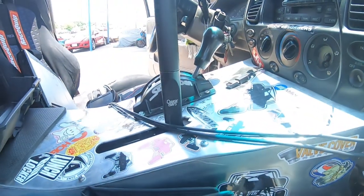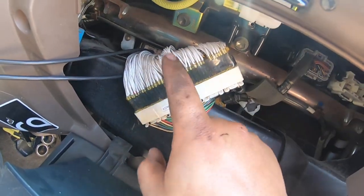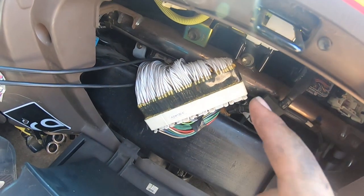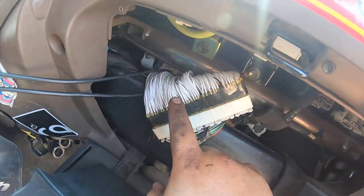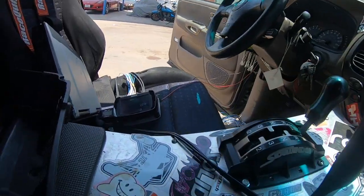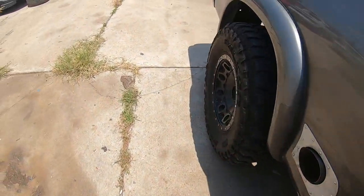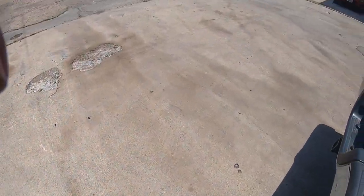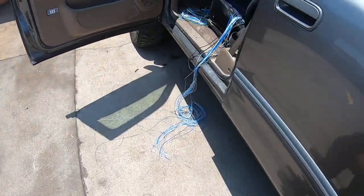Because this truck is still automatic, we're running a dual ECU setup. Just like I tell everybody, when you're trying to do something crazy, you need to do the bare minimum to see if it works. So we have cam and crank hooked up going straight to the FuelTech. We have constant power and ground on the FuelTech — it's not even hooked up to key-on power or anything like that, just straight power. This is the bare basics to get it going.